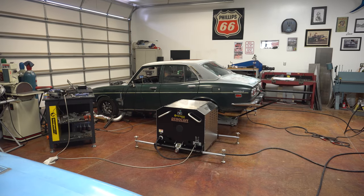So this ramp run, because it holds the car back so far, if it downshifts, it's gonna put a lot more leverage on the drive shaft, tranny, everything. So I'm gonna try to go into HP Tuners and change the settings for where the transmission will upshift and downshift, and then try this again. Hopefully it doesn't downshift real far and put an extra load on the car. So I'm just gonna look at my settings real quick and see if I can help that from happening.